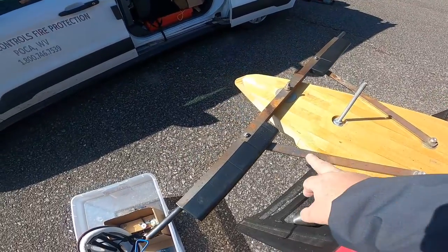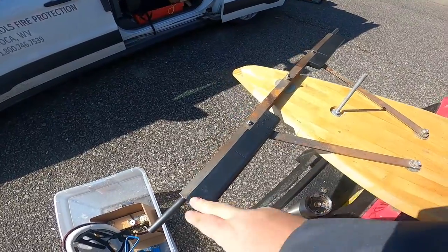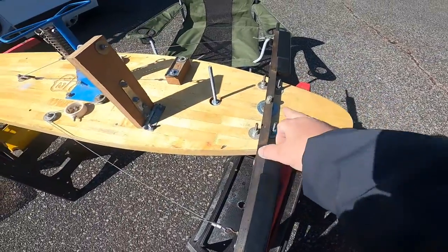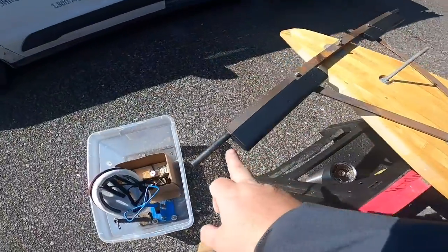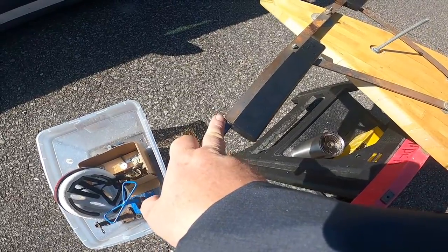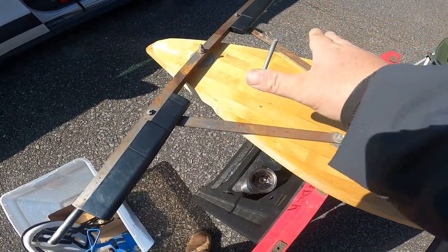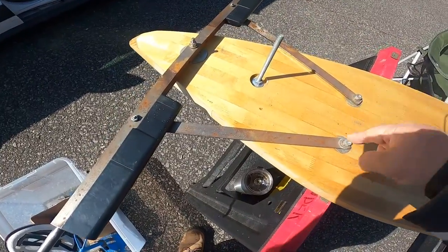As far as the rear goes on a stock car, which is what this one is, these are rear axle stabilizers. You want to measure from the king pin here to the back edge of the axle on both sides. You loosen these bolts and it gives you a little bit of play, but you want to make sure it's exactly the same on both sides.